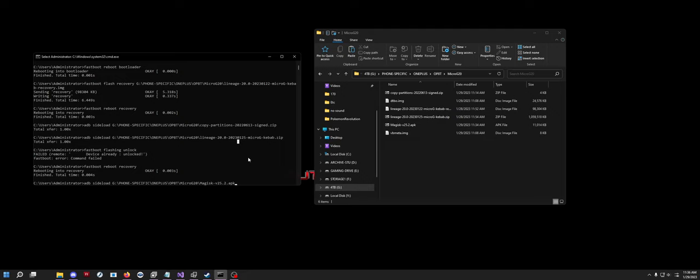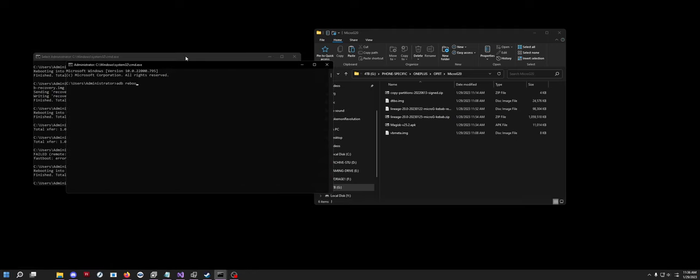So I'm all booted into LineageOS. I'm making sure I still have an IMEI because this thing is freaking terrible. I do, thank God. I have two IMEIs. It's so weird because I only have a single SIM slot. Anyway, now you want to reboot if you want your Magisk. So, I need a different window because I'm not willing to retype that. ADB reboot recovery.